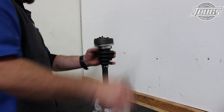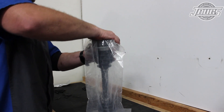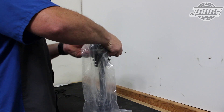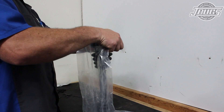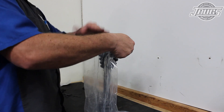The boot and flange are pulled back up to the CV, and then we use the packing bag to seal off the end of the CV as best as possible. The axle shaft is pushed into and then pulled out of the CV joint to pack the grease into the joint. The process is the same for all the joints on both axles.